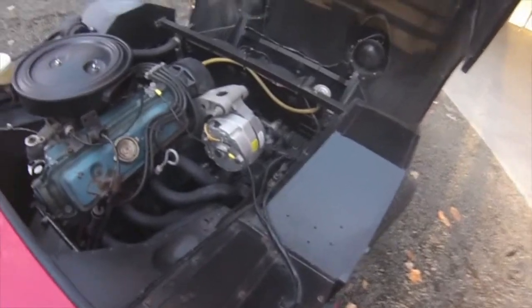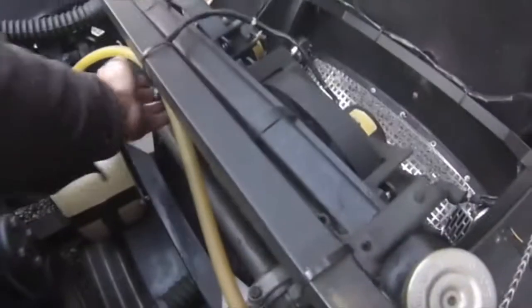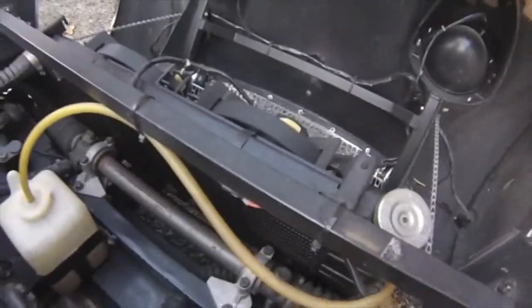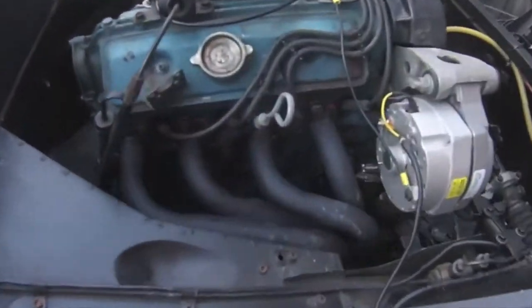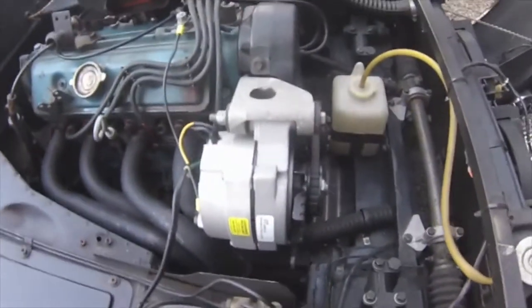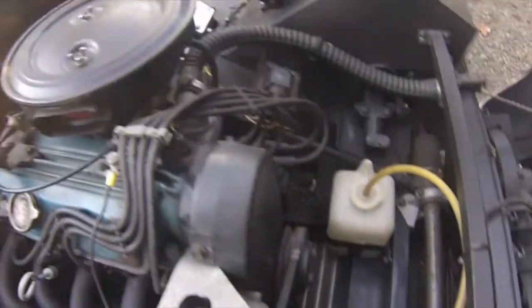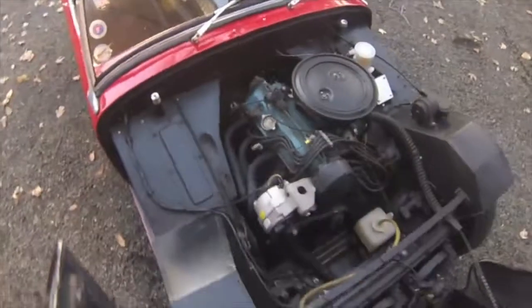The prior owner that had this car used it about 12,000 miles with good reliability. It has the transmission oil coolers underneath the washer bottle — you can just see it flat there. Air comes up underneath it, and those are the killer fans. There's one on now, and when that second one goes on it really moves a lot of air. They're both controlled under the dash and also thermostatically controlled. Again, it's just a very high quality build.